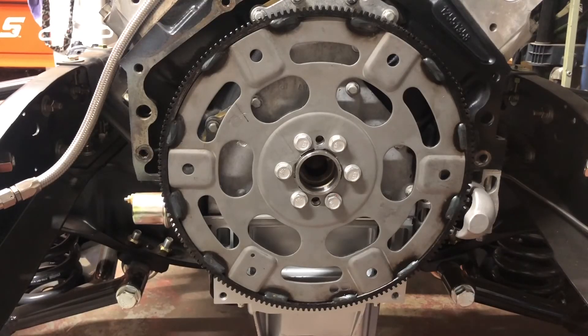That's all it takes to install the 4L80E flex plate onto a 4.8 or a 5.3. This flex plate would probably even work for the 6.0's with the shortened crank. The 99 to 2000 6.0's and 4.8's had the longer crank where you didn't need the spacer, but with a short crank you do. If you enjoyed the video, like, comment, subscribe, share — we'll catch you on the next one.